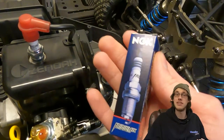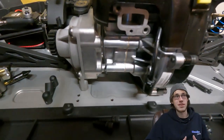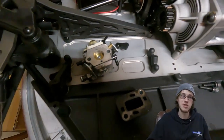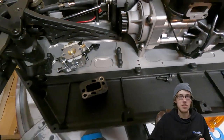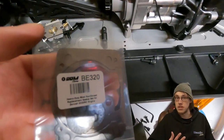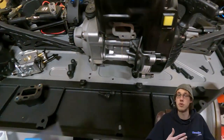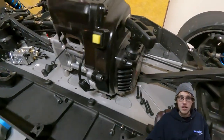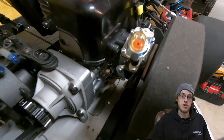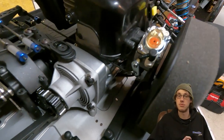The next thing is a steel gasket kit. Methanol really eats away a lot of different materials over time, and having a steel gasket kit works out well. It was kind of hard to find — I found a steel reinforced gasket kit that worked out pretty good. Then, depending on what kind of motor you already have, you might need a larger carburetor to get more fuel in, because running methanol takes a lot more fuel than regular pump gas.